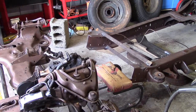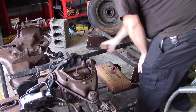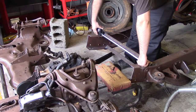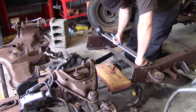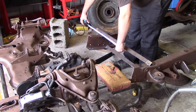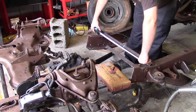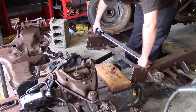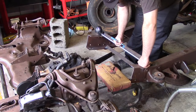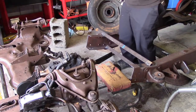Takes out the guessing. Here's a piece of metal. Thinking something like this. I can tack weld that in the center. I can do that. So 1 foot, and then add the 3/8. Now these measurements should be the same. 1 foot 1/4, 1 foot 3/8. Sheesh. 1 foot 1/4. Measured again. 1 foot 1/4. Let me go in between 1/4 and 3/8, right there. Give it an extra lip. Sweet.